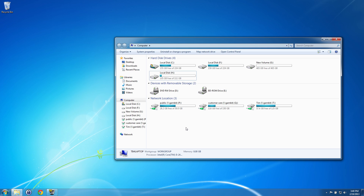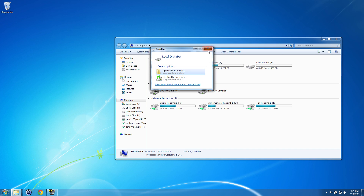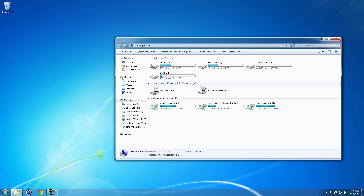Again, we can simply see where the drive is and disconnect it — you'll see the H drive is the one that disappears. These letters will vary for you. And when we plug it back in, you're going to see in a minute or so that the H drive reappears as a new hard drive. That's an easy way to tell which one of these drives is the hard drive we're plugging in. Now if it doesn't show up, go into Computer Management and check there — see if that hard drive is showing up when you unplug and plug it back in. If it is, it may just need to be formatted and you may not be able to recover information from it. If when you plug it in nothing is detected, make sure the power is connected, the cable is connected, everything looks good. If it's connected and still doesn't show up, the only two possibilities are the hard drive is defective or the adapter cable is defective. The only way to tell for sure is to try it on a known good hard drive.